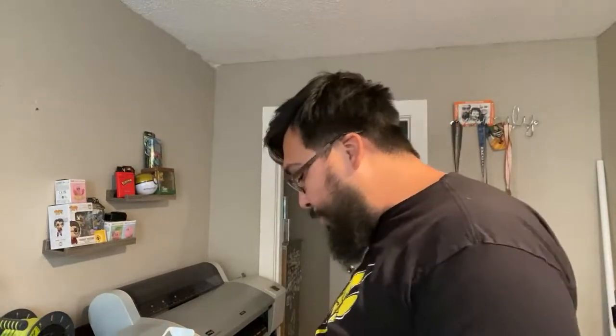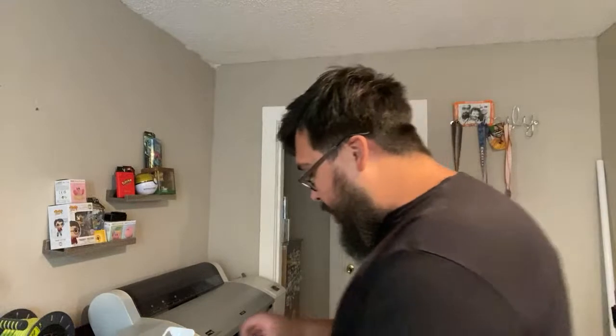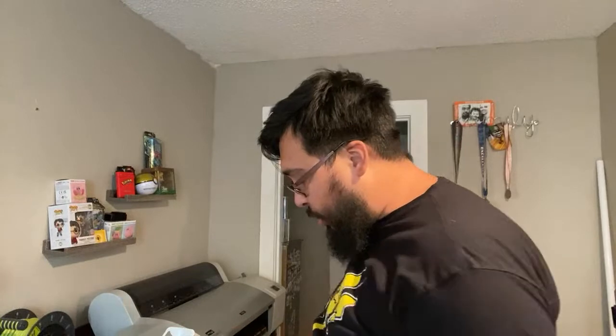Yeah, James, so I wasn't very patient initially, and that's how I delaminated my R1800 print head. Not fun. Very sad moment because I love that printer, and now it's just collecting dust in my shed. But hopefully I can find a print head very soon. But yeah, just leave those print heads soaking. If you guys have any issues with head clogs or cleanings, that's the best thing you can do. Just let them soak. Be patient. Don't underestimate patience with DTF.